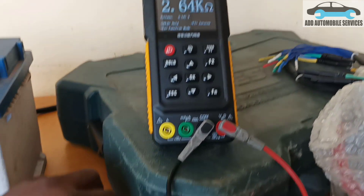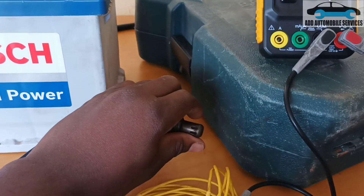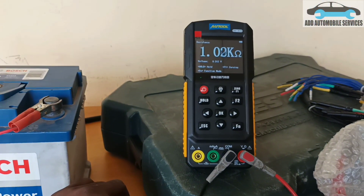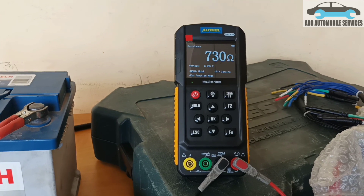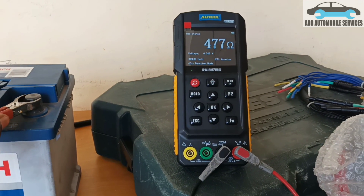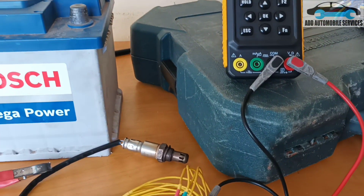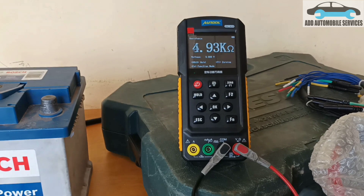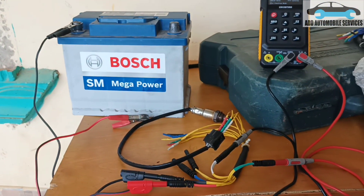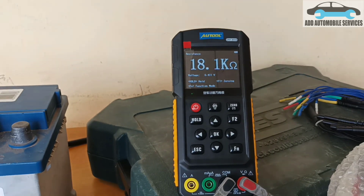There is a reading on it, and I can feel the heater circuit — or the oxygen sensor — is getting warmer. And you can see it keeps reading downwards. So now let me disconnect it, and you can see it is reading back upwards quickly, because I've disconnected the heater circuit from it. So now I've disconnected the heater circuit and it is reading upwards again.